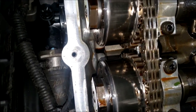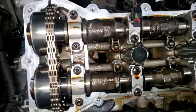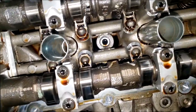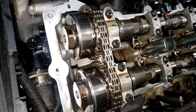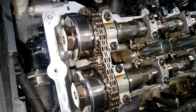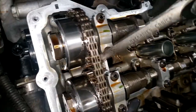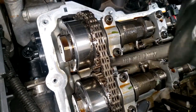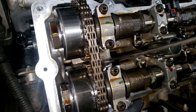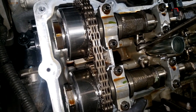The phasers are new and they're OEM. Had they been aftermarket, that would have been the first thing I'd recommend — get those junky cam phasers out. But because they are new, I won't bother those. A couple things of importance: I want you to be aware of these two screws under the phasers — these are oil galley plugs. If they are loose, yes, they could disrupt VVT operation.